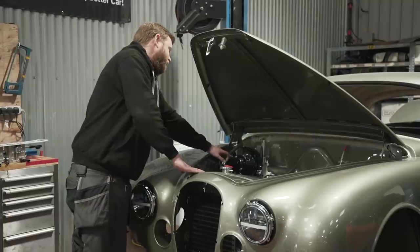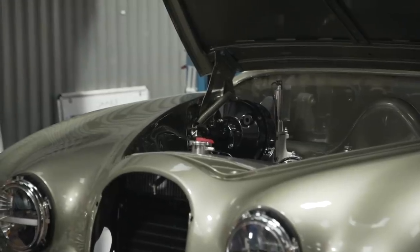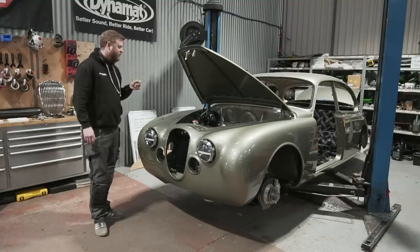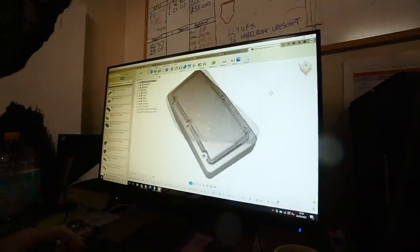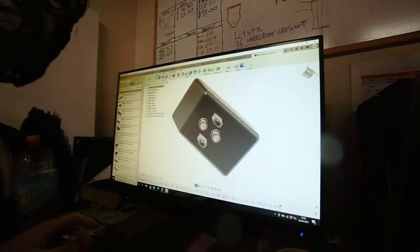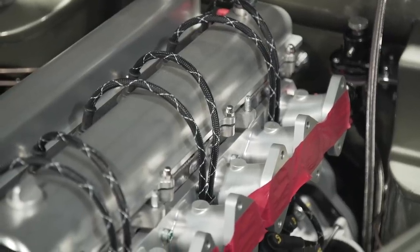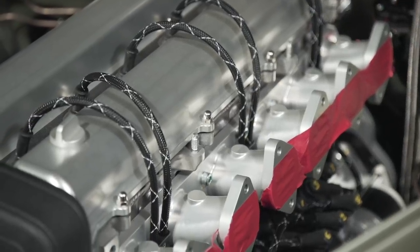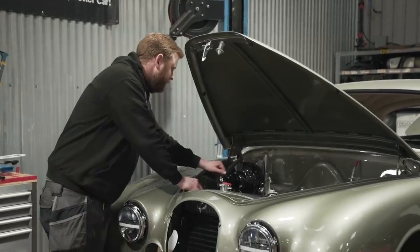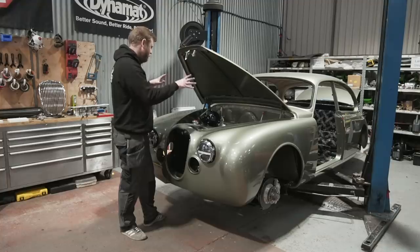The final piece in that puzzle was the brake reservoir. Originally we had the original X300 plastic one and didn't really have a plan to change it, but having seen everything else in the engine bay it just looked completely out of place - stood out like a sore thumb. So we've decided to do our own aluminium reservoir. Adam's designing it now - there'll be a nod to the cam covers with that corner radius, and we're pretty much mimicking the way we used dome nuts on the cam covers. The brake reservoir will have M4 dome nuts holding a billet top cap, and the whole reservoir will be silver anodised to match the cam covers. That will pretty much bring the whole look of the engine bay together.